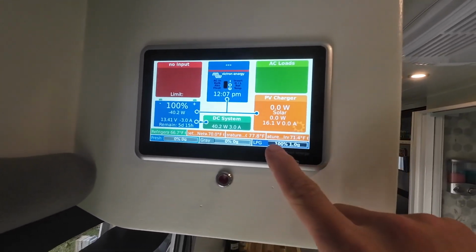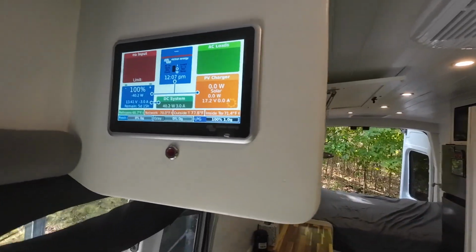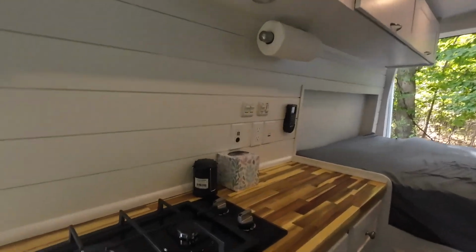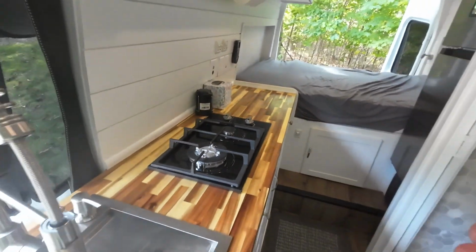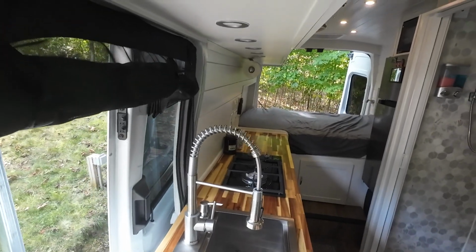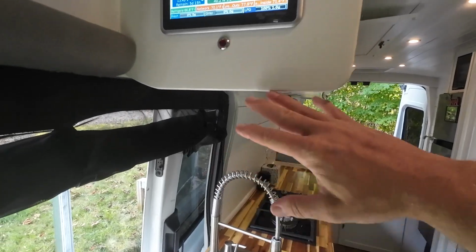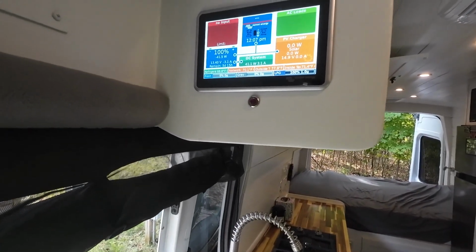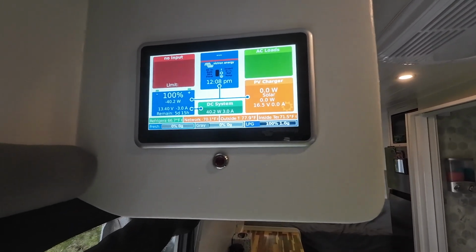For instance, my tank sensor for propane is a Mopeka Pro. It uses Bluetooth Low Energy, and you can actually use them on water tanks. If we look under here, the bottom of this little propane tank, you can see it has magnets, and basically it uses sonar to read the level in the tank. Like I said, these can get an adapter, and you can use them on your water tank using sonar. Now, I don't know how well it works with it sloshing around and all that, but for me, I'd already wired up those, so some of this wireless stuff was an afterthought, so it made it very easy.